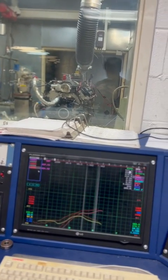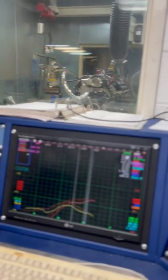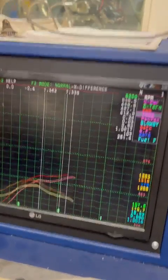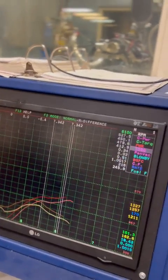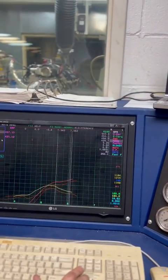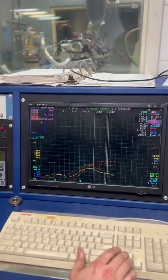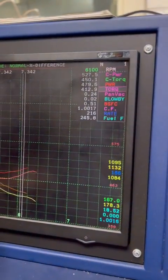A little 6400 pull — yeah, let's get the tune set up here. Let's see the difference between the truck manifold that was on it in the last video versus the FAST 102. We hear they're not making a lot more power, so we wanted to see what they did at higher RPM, see if it was worth anything. So far I put the FAST on there and it lost power everywhere.